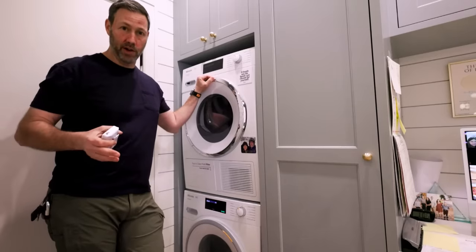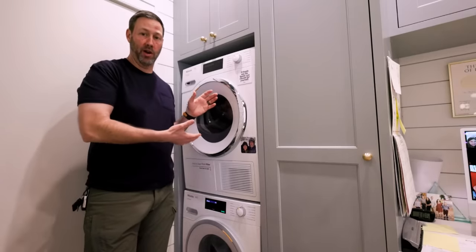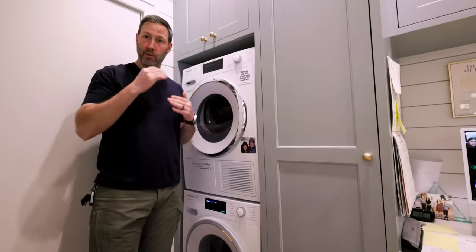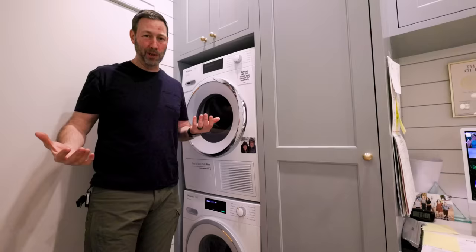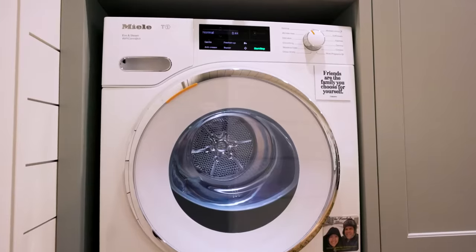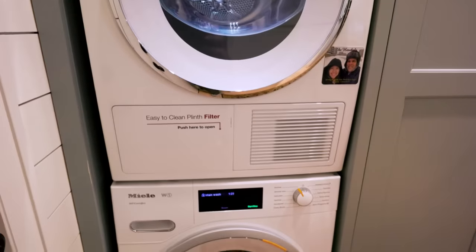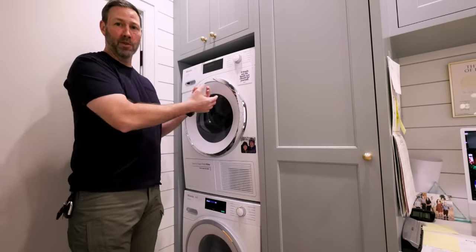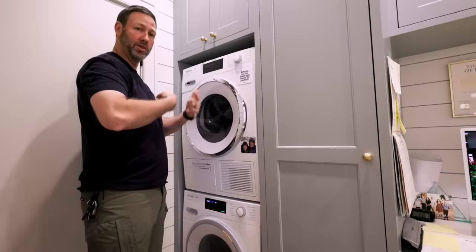There are a bunch of negative reviews on the internet about these ventless dryers. If you go to a site that has this laundry equipment, it's usually like three or four stars - people either love them or hate them. I think there are a lot of misconceptions about the equipment. This dryer is a heat pump, which is basically a dehumidifier in a box. You're recycling the air, heating the air, extracting moisture from the clothes, then cooling the air to get a dew point, dropping the moisture, and then recycling that air.